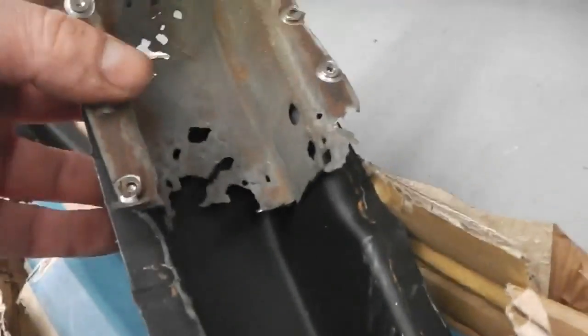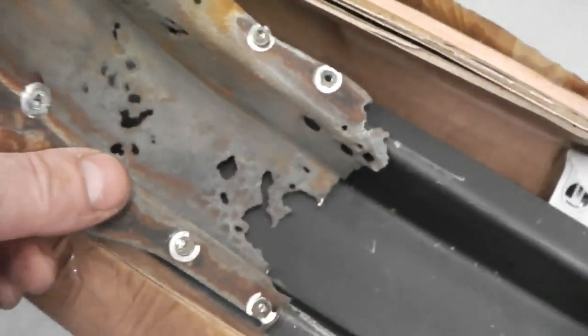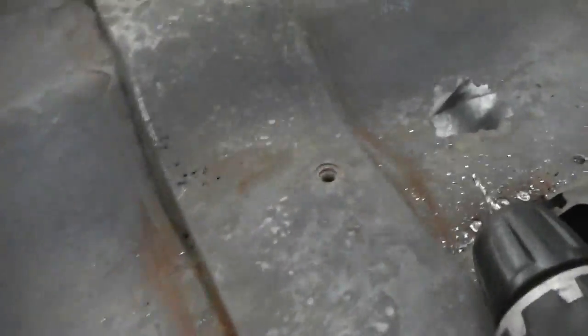I'm just looking at that profile there, the ski jump profile. That's going to be going up by the bulkhead. So a pair there, 70 quid. I think that's good value for money. Available from Magnum. I got these from eBay. So I'm going to look at this unboxing of those and just make sure they line up. Then we're going to go on to the actual car itself and start drilling some spot welds out. Lots of spot welds in the series, ladies and gentlemen. As always, spot welds are key. We need to get things off nice and clean.